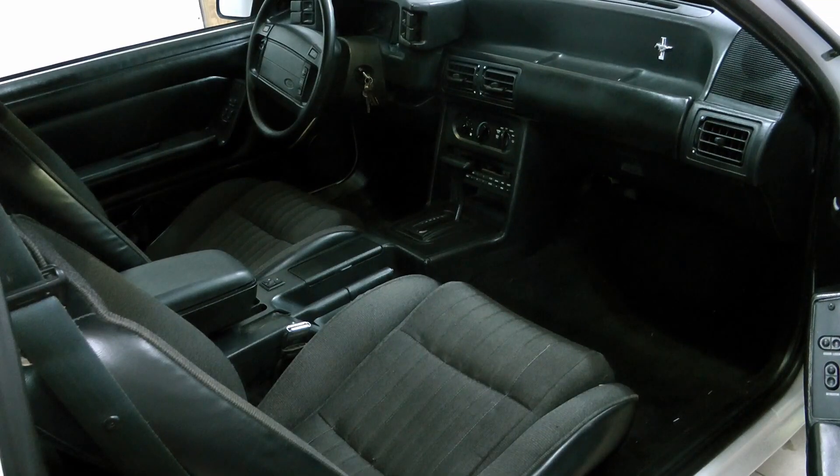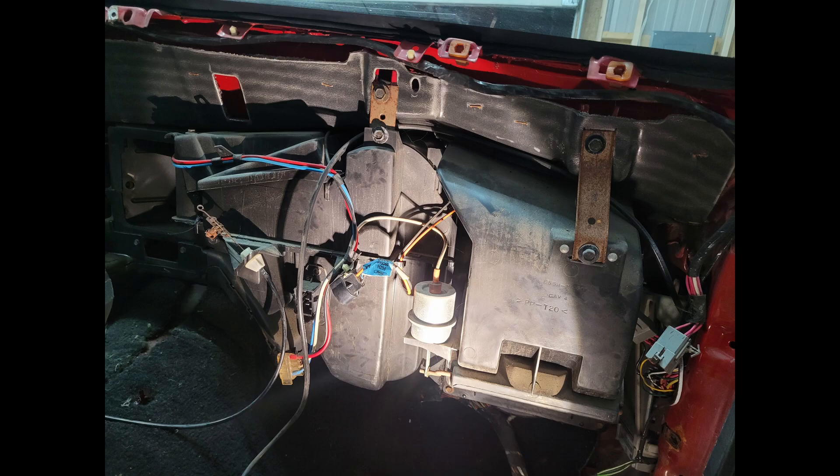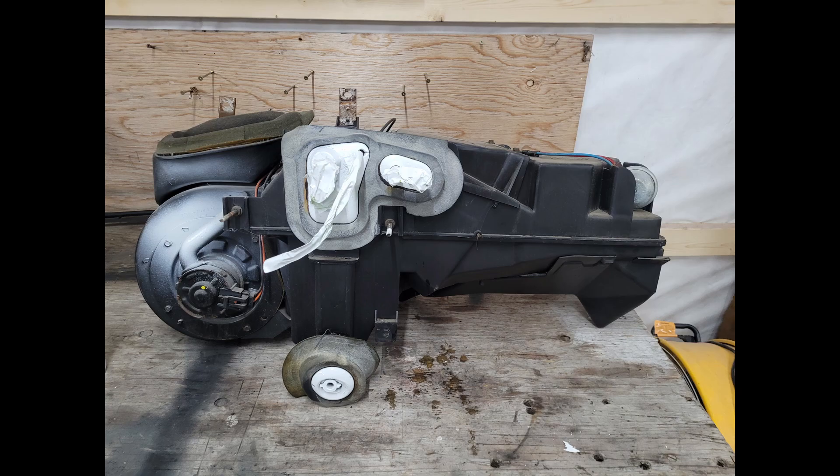If we take a look in the car, this is going to be one of the tougher parts — you really need a factory AC box for your car. The purpose of this is that it holds the evaporator, which is the part of the AC system that absorbs the heat from the inside of your car. For this car the evaporator was in the factory box in the factory location. I did switch it — I put a new evaporator in and I would recommend that if you're doing this type of work on your vehicle. The critical, almost holy-grail hardest item to find is probably going to be the factory AC slash heater box for your vehicle.